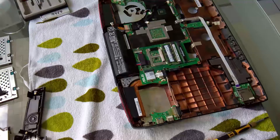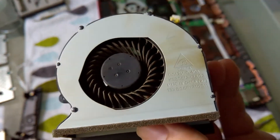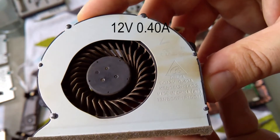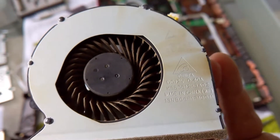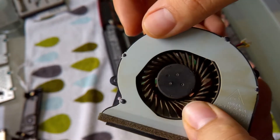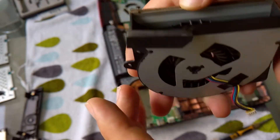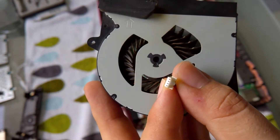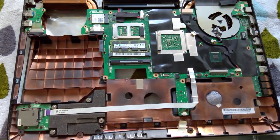We're going to start off with the fans. This is the fan and as you can see it's a 12V. This is what you should be looking for if you're buying a replacement one, because I got a question about what exactly the type of fan is. They cannot be opened or oiled unfortunately, because you cannot take out the fan blades in order to oil them. It's worth knowing it's a 4-pin, and this is essentially what you need if you're looking for a replacement.